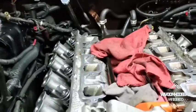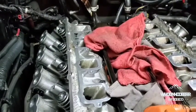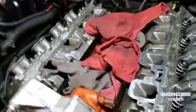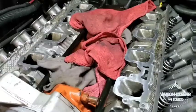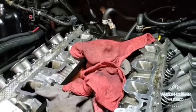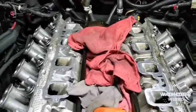Still going back and forth on which supercharger I want to go with. I talked about the Torque Storm — the budget is around three to four thousand dollars, which makes it tough. I really want a positive displacement, but it's hard to find one for that cheap, especially for a pre-Eagle engine. Could probably get one for a 6.1 and get the adapters if needed. If not, we'll probably go Torque Storm with the smallest pulley they have, which is a 3.10, and see where it takes it — not trying to get close to 600 wheel on 93 pump gas.